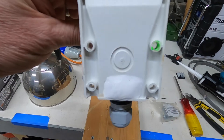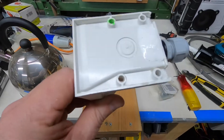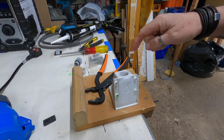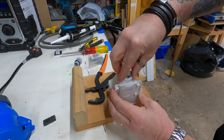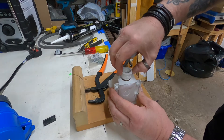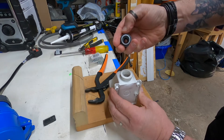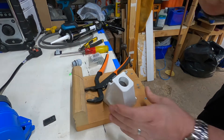We've got that hole now filled with white Sikaflex. So I think now we can bolt it up and see how it looks and see if it's going to work properly. Before I put it back on the van, I've got this little grommet — screws in there — and then we've got another grommet with a rubber seal for the cable that screws into that. So before I get it all in place, I'm going to get some Sikaflex around here, seal that in so no water can get in the back. And then I'll do the same with this one, although this one has got a rubber seal, but I'm still going to put a bit of Sikaflex around that one as well.